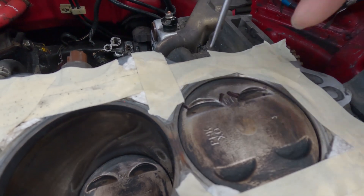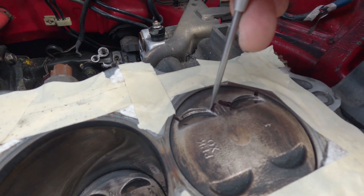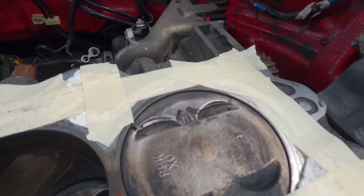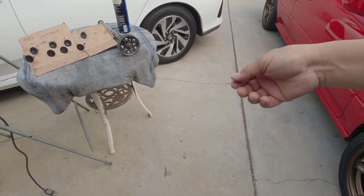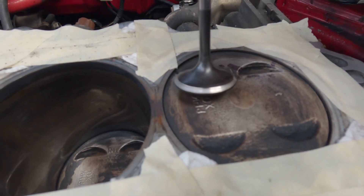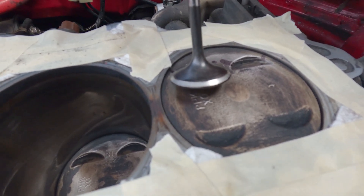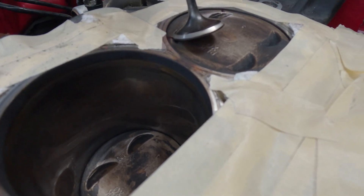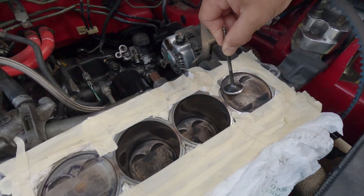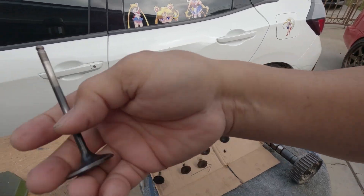I'm not sure how thick the material is to the first ring groove, so I'm going to try to minimize as much as I can. If I grind this area — the previous marks that the valve created — I should be okay. Let me get the valve so you can see it. Yeah, it made its own seat right there, so that's all I need, since it's at an angle. So far I have found one valve that is bad.